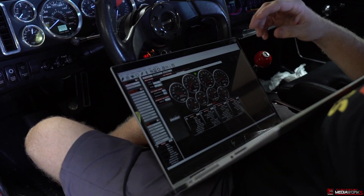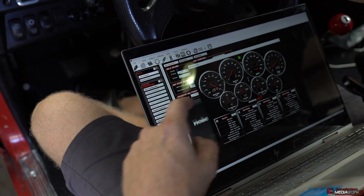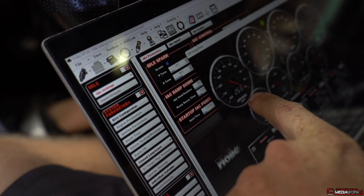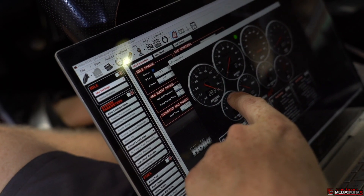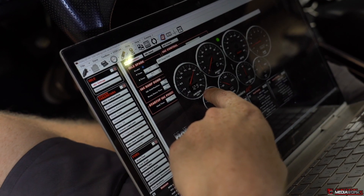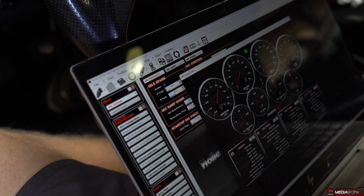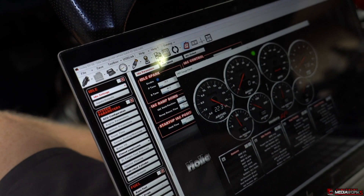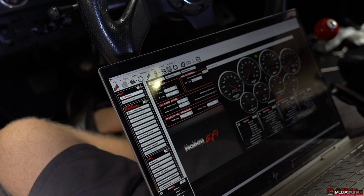I just spotted a major discrepancy. I was saying how I like that gauge, but that gauge does not at all match what the ECU is actually reporting. I feel the ECU's number is our actual number because the car sounds super lean and unstable — like it's going to stall if I barely blip it. It didn't stall, but you see the number perked right down. Let's go into the fuel table. If you listen right now, you can hear that the car is very much stable. All I've done is change fueling in that lowest range around 800 RPM and down below, and of course the car is now in open loop so there's no learning going on.